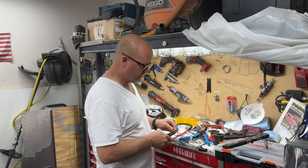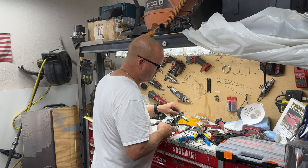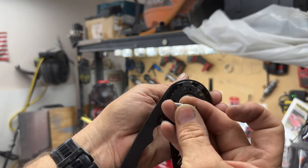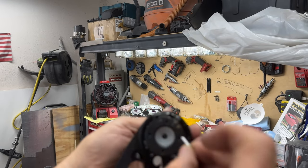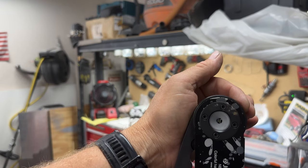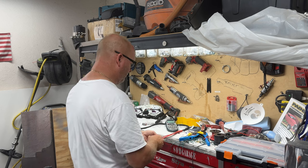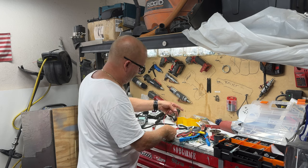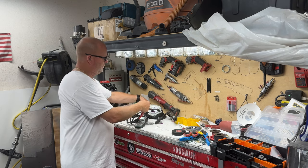All you do is take the longer end of the pin — there's a longer end — put it in there, there's a little stop. As you squeeze it, it's got four teeth that bite down and crimp it. Then you put the wire in, squeeze it all the way until it locks, and pop it out. We have all the wires done. It pops right in and they click into place. We've got the light in there, and the last two are the ground and the power. There we go — we have our speedometer wired up. We've got the female version of the plug too.